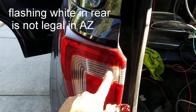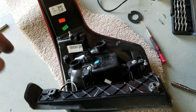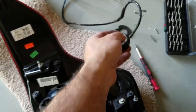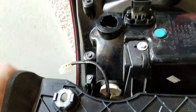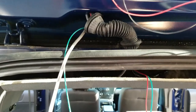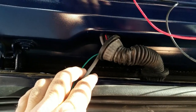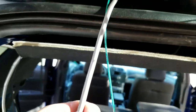They're mounted in the clear area, so we needed to get red strobes. I took the taillight out. I took this — I believe it's an Abrams LED light — that really didn't work well in this application, and I put in the strobe. So I'll go ahead and put it back in the truck. I used one of the existing wires that I had going to the LEDs going down through the gland, then connected this green wire to it, and used that to pull the strobe line through.